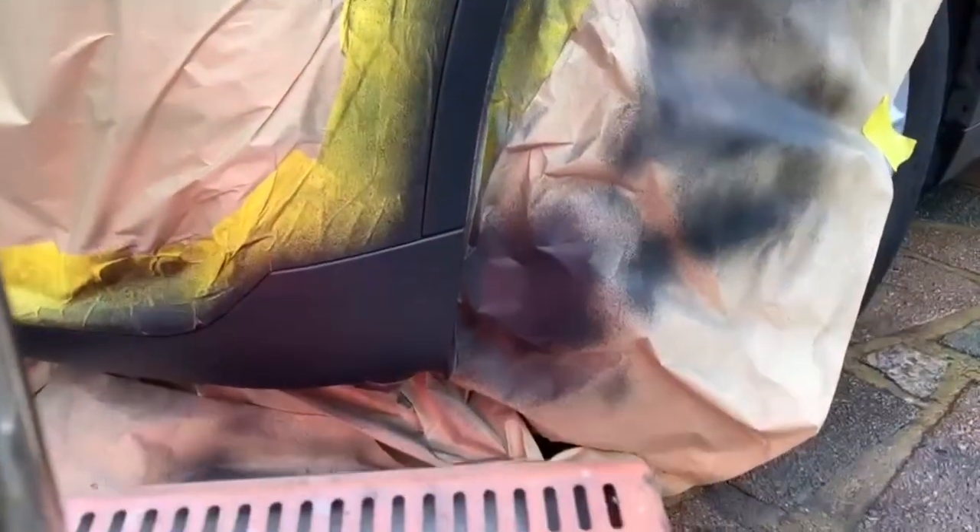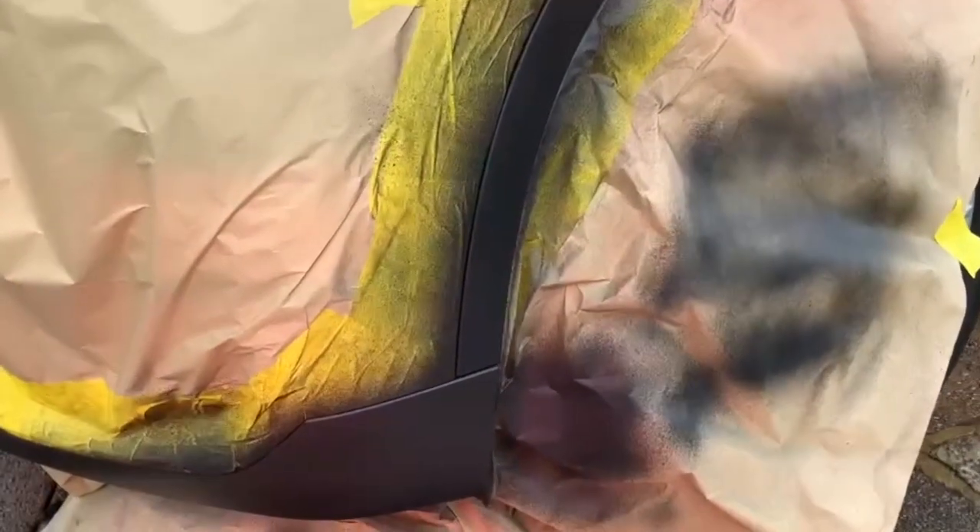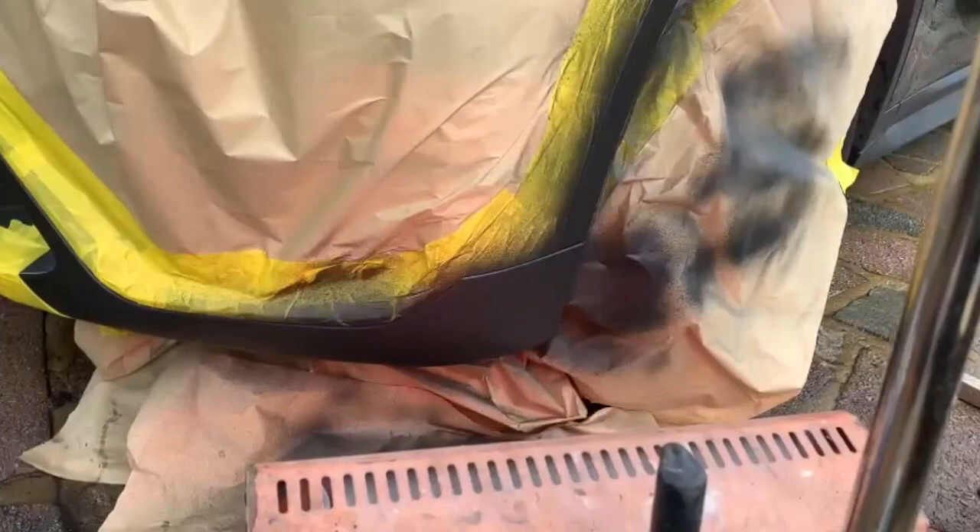Trims are now drying following the application, with infrared lamps. It's so important that these trims are dried 100% thoroughly, because I'm going to need to mask on these shortly and we don't want it coming off. Good infrared for about 15 minutes, then we'll pull that off and start the next process.